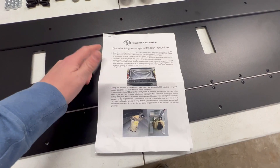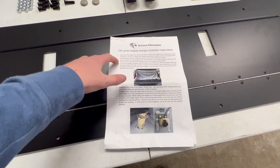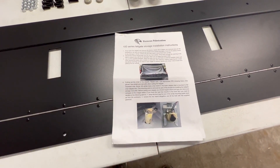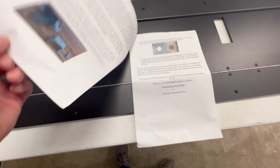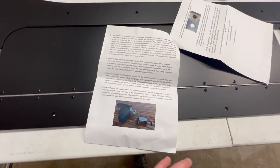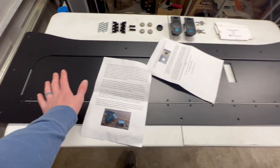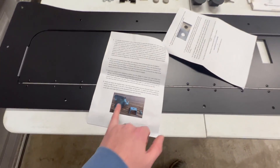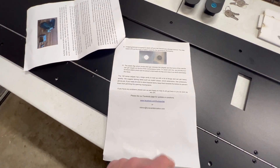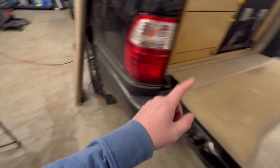Here's a quick overview of the installation steps: remove the carpet, get everything out of the way, cover up your truck, put the template down, trace it, remove the template, cut it out, deal with the lock cylinder appropriately. They recommend using an angle grinder. Then clean up the edges, spray paint, install the sound deadening, install the cover, and adjust the latches. Also deal with the grommet hole and watch out for the plastic lip catching.